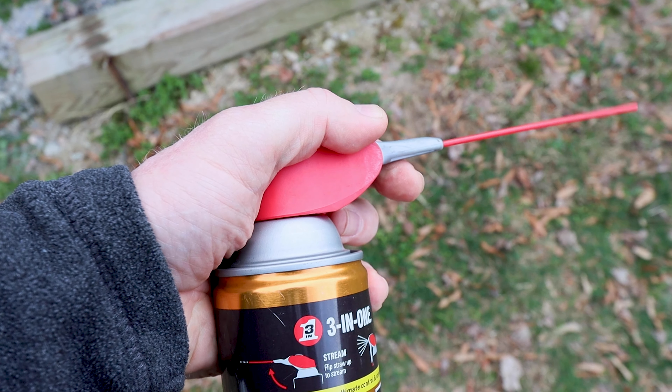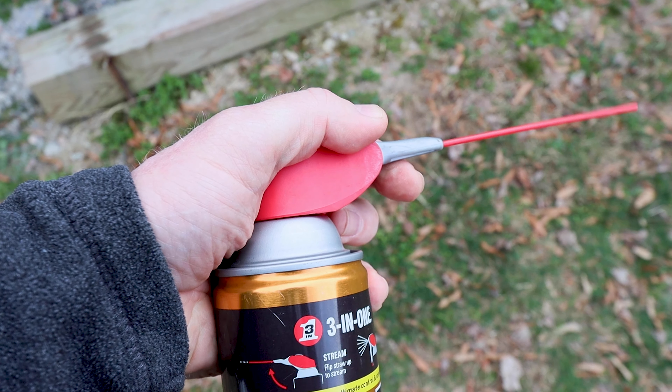Now that we have the slide-out in, we want to get the inner seals done. The inner seals right here are just like on the outside, and you want to treat them the same way. Typically you'd want to wipe them down before putting the seal lubricant on, but I do mine at least once a month so I just want to show you for demonstration purposes. You can wipe them down with a little cloth and then come back and put some spray on to protect them. You'll have seals on the side as well as on top, and the 3-in-1 has a little flip-up nozzle with a tube that lets you reach further when spraying — that comes in really handy for the seals up top.